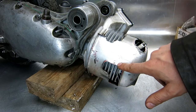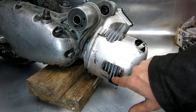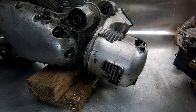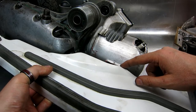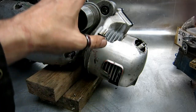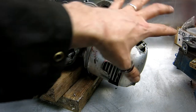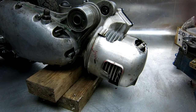The other thing that people don't think about is why this cowling has got this shaped slot in it. The whole point of this is to do with the running boards. If I put a running board up against there, you see it's got this raised lip on it. The point of the raised lip is to ensure that the hot air that comes out from the cylinder goes out under the floorboards - it doesn't heat up your fuel tank, your carburetor, or your inlet system.